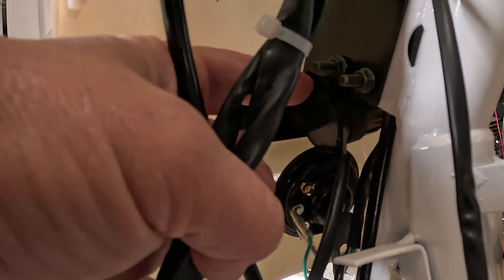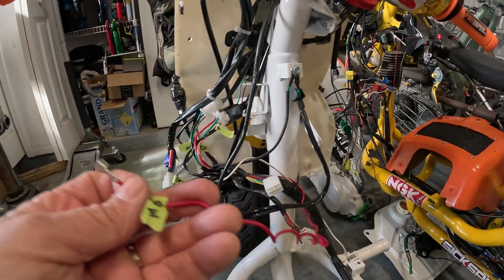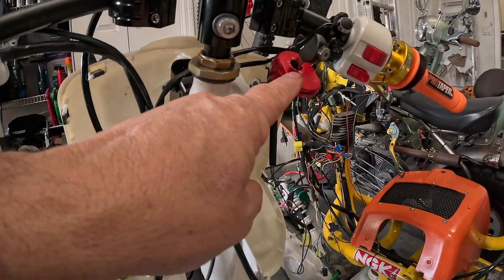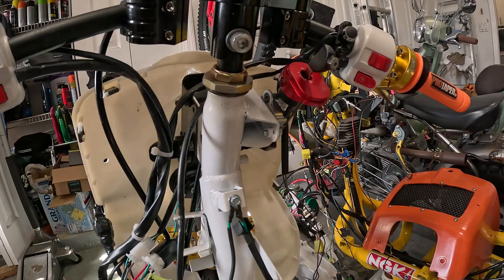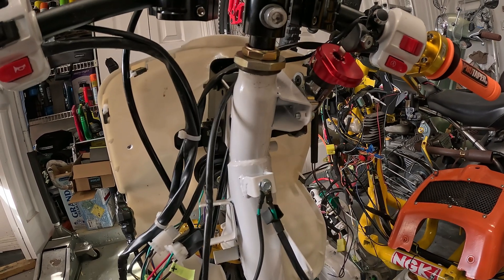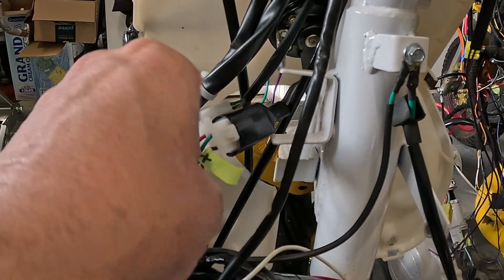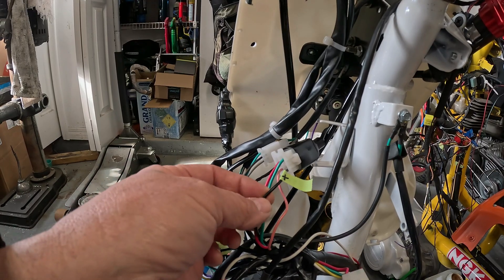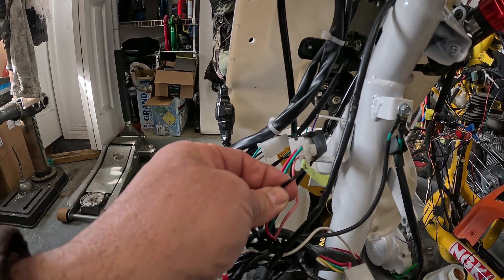Up here is a flasher relay for your blinkers — left that connected. We're going to take the power from the battery pack, 96 volts. It's not going to be a lot of amps, so the wire can be small, but we're going to bring 96 volts in to the system before the key. This is the wire that has the fuse on it. When we turn the key on, we're going to send 96 volts back to the controller. The red one is the 96 volts going into the key switch, and when it comes out it's going to be this black one. We're going to split it off there — run one side to the controller and the other side to a DC-DC converter. It's going to take 96 volts and turn it into 12 volts.